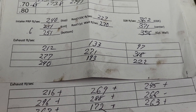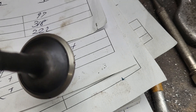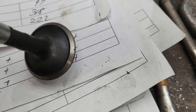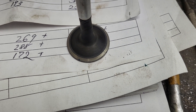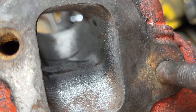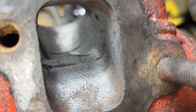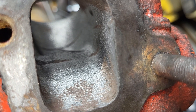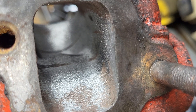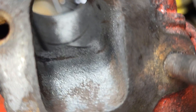The exhaust valve — it's hard to see because it's dark — but notice it has an evaporation ridge. I don't know why the exhaust has an evaporation ridge, but I don't think it's a bad thing. You guys can comment on why. As far as getting something we can test the four-barrel on, we're only at 190 CFM through our intakes, whereas the ones I sent to DV's were more like 230. They still need quite a bit of work to be a decent test head.